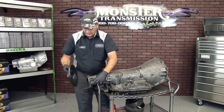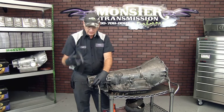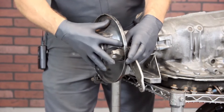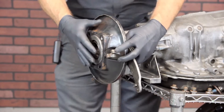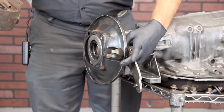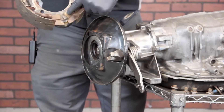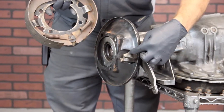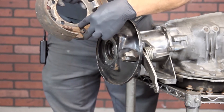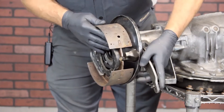The next item is the rear shield of the brake drum. You'll notice it has a hole here — that's where the brake mechanism fits through. It can pretty much only go in one position. Next is actually the brake shoes and brake assembly. Right here is where this brake pawl will actually line up between the shoes. It's very important to line that up, so obviously it has to go in this direction to line up onto the rod.